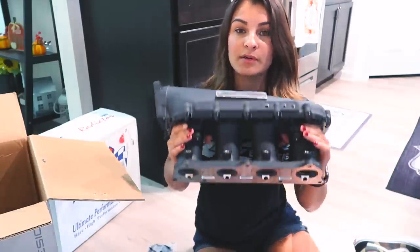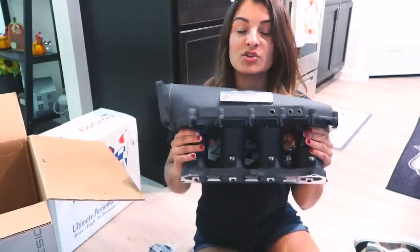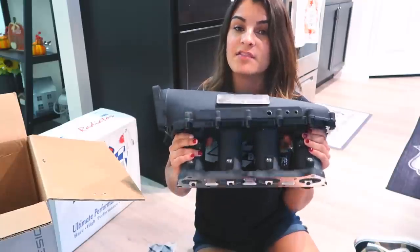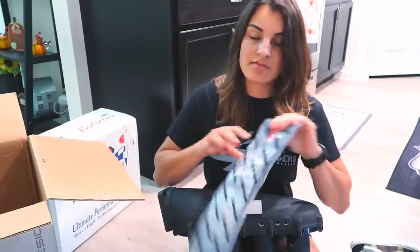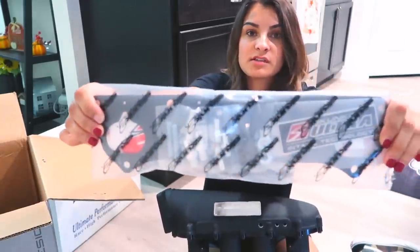The last piece to the puzzle will be to get a throttle body for this. I'm not quite sure which size I'm going to go with. My car currently has a K-Tune 72mm throttle body and I think I'm definitely going to have to go bigger with this setup. I made a post on Instagram asking everyone what throttle body they think I should run with this manifold. Majority of the answers were a 90mm throttle body and I believe that's what I'll end up going with. When purchasing a Skunk 2 Ultra manifold, it comes with the gasket and everything, plus a separate bag for the install — it even has the bolts included.